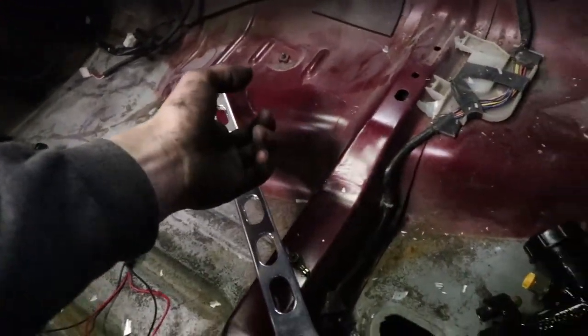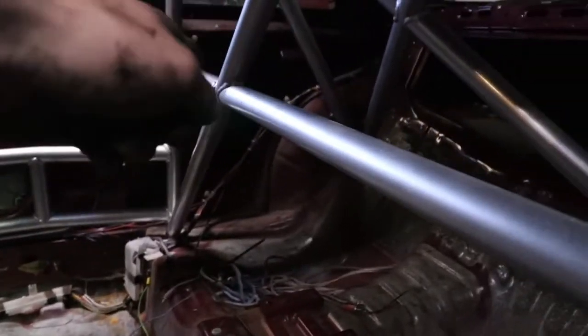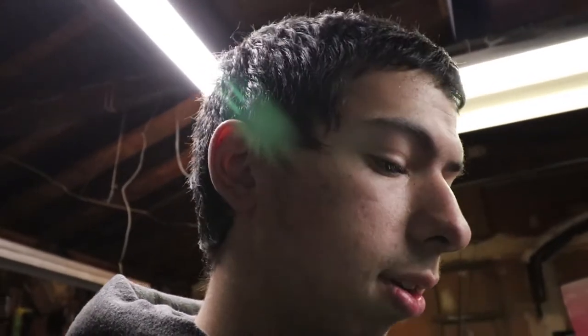They'll usually put like a bungee cord in it and tie it back to the cage or something back here. No, I don't like that. Because basically you're using the fluid to lock your e-brake. If any fluid bleeds off, your car's gonna roll away or whatever, you know? You want a cable, so that it's just tension on a cable and it's less likely to break or bleed off or whatever. So I'm stoked on that.